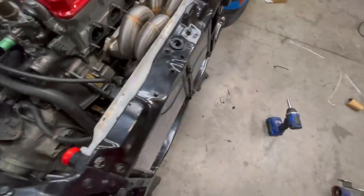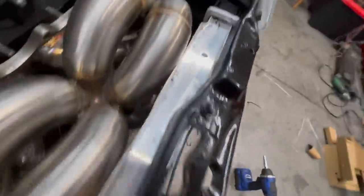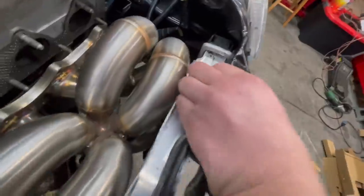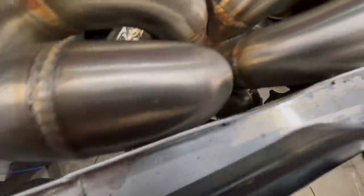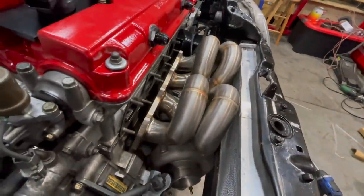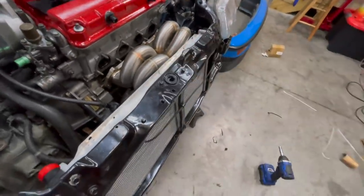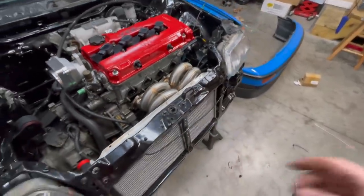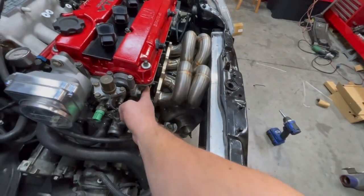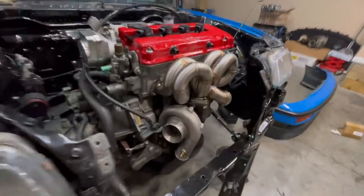Before I started cutting, I tried to see if I could get this to bow down and go in without any trimming. It does go in but pinches a bit on one side, so there's more room to work. The problem is finagling this manifold up and in is a pain in the ass with how tight this is. So I'm going to pull the T-bar back off, pull the radiator out, bolt up the manifold, and then see what the fitment looks like. I have plenty of space to come forward, but I can't get it up and over the studs until this is out of the way. Manifold bolted up loosely — radiator in.